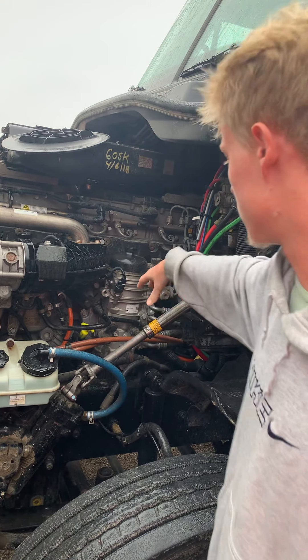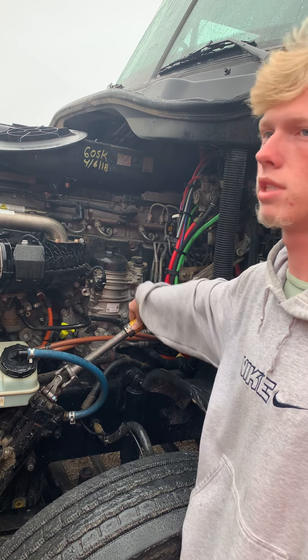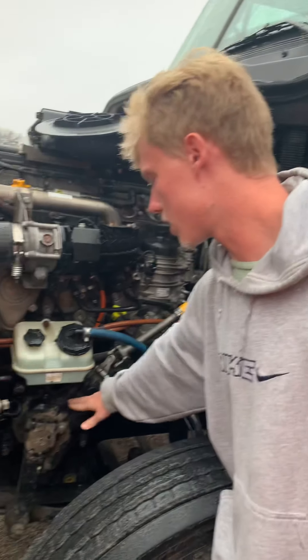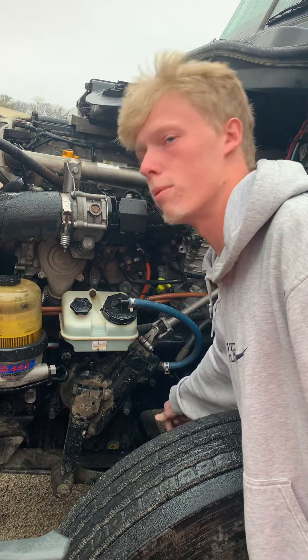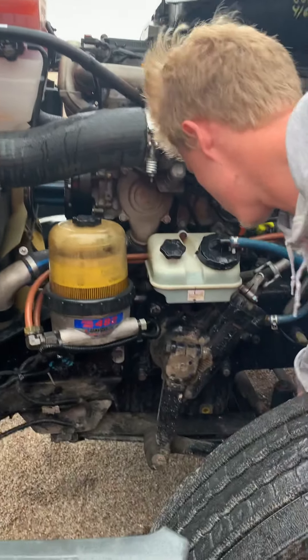You're going to come back here to your steering shaft. I got my steering shaft, properly mounted and secured, nothing been broken or cracked, and there's no more than 10 degrees of free play on a 20-inch steering wheel. My steering gearbox is properly mounted and secured, nothing been broken or cracked, and there's no leaks. My three-piece steering linkage is properly mounted and secured, nothing been broken or cracked, and it's held together by three castle nuts and cotter pins.